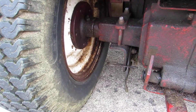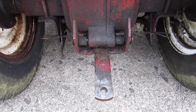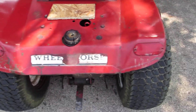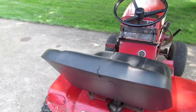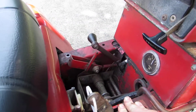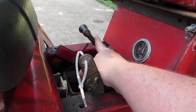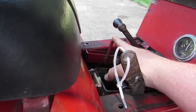These cotter pins come out here and you can mount a dozer snow blade - I think it's a 42-inch, they make pretty cool attachments. Here's your fuel tank up front and your fuel shutoff with the Wheel Horse logo on the back. That's your reflector tail lamp. I don't think this is an original seat - doesn't look to be the Wheel Horse original. Down here - I have a couple parts off - there's a panel that goes here which is off. Moving this up and down disengages and engages your hydro - this is in the disengaged position. Up controls your attachments: the hydro attachments for moving your deck up and down, your dozer blade, whatever you have hooked up. This is for the brake - push that down to set the emergency brake.